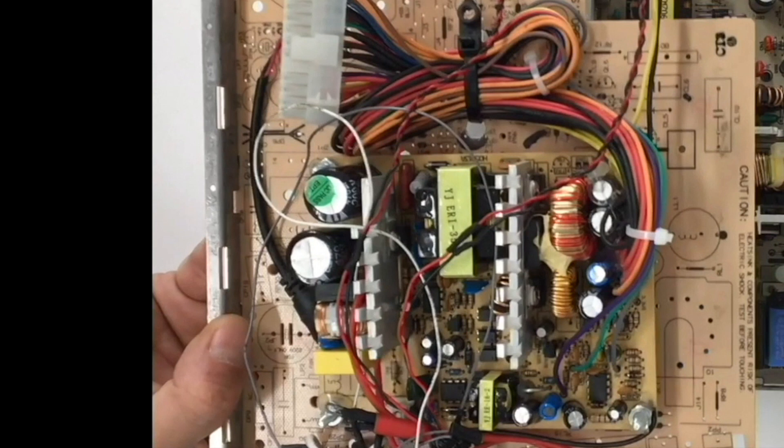I was a little worried about losing the cooling fan that was mounted on the casing. However, the original iMac cooling fan — which I'm going to install directly over the processor — was powerful enough to cool the power supply and analog board in the original iMac. I think we're going to have really superb cooling on this one. I didn't see where I needed the additional fan on the power supply anymore.